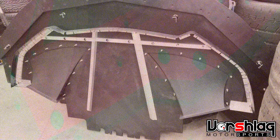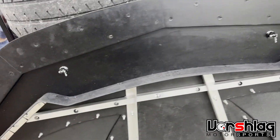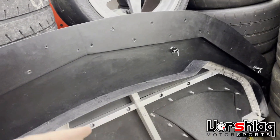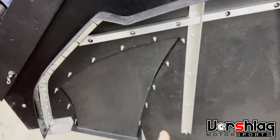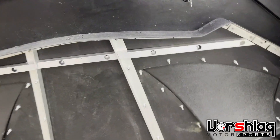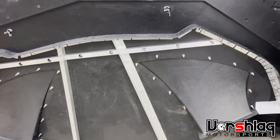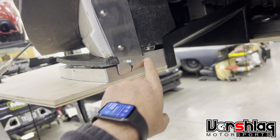Laterally, this is a splitter off of our Mustang we call Trigger, and it has some of the same structure — it's got the one-by-one aluminum tubing there, which gives a lot of lateral stiffness. We have to cut out the plywood for the Professional Awesome ramps, which takes a lot of structure out along both planes. Fore-aft, we have the inch-and-a-half aluminum structure, and we have some structure on the ends that we bolt to the bumper cover, just like Brad has done on the current build.